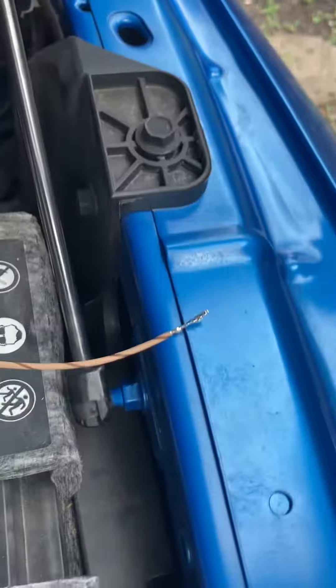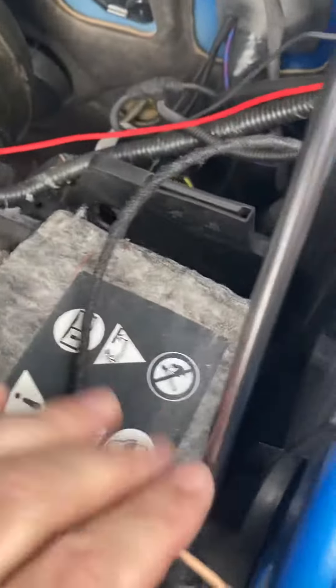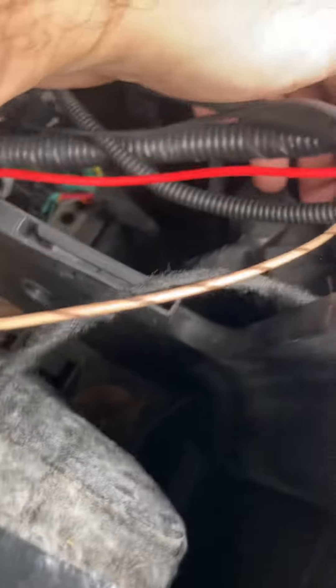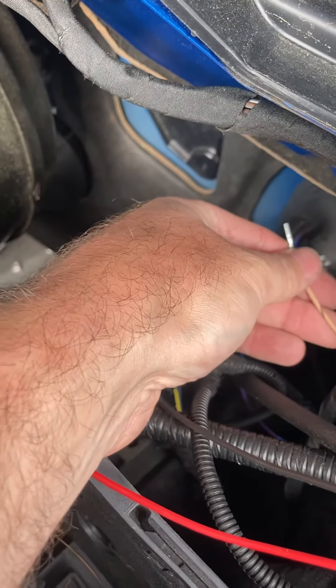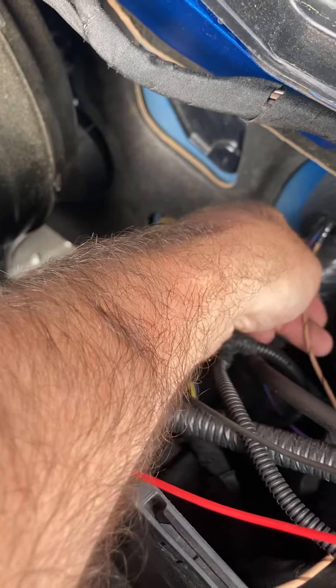I have all this slack, so what I did was bring it down through the corner. What you want to do — the OEM instructions say you put a hole in the boot here — grab a coat hanger and tie this to it, push the coat hanger all the way through so you can see it on the inside, then just pull it through into the cab.